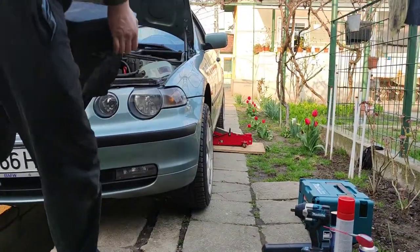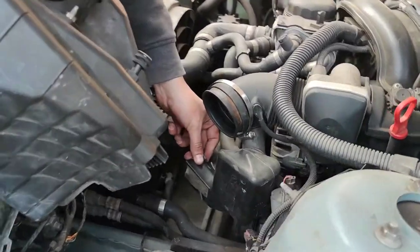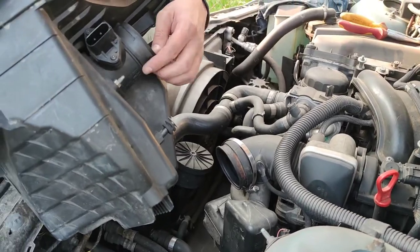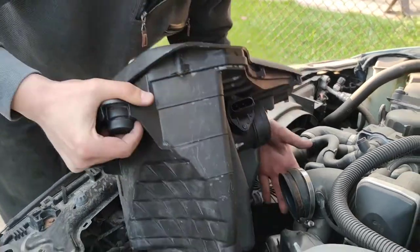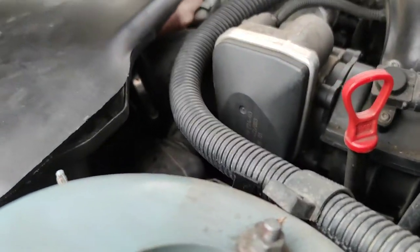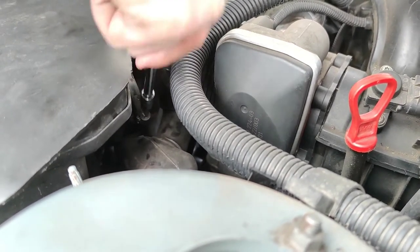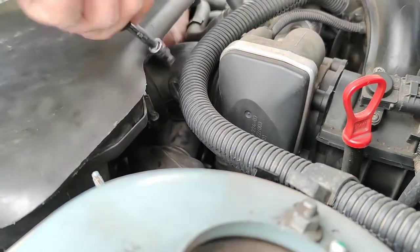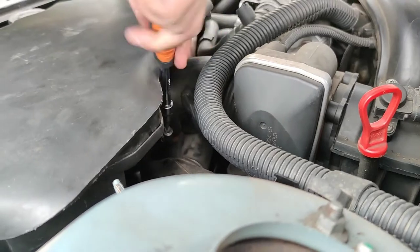Now we can put back the airbox. Put this little thing down here in the other airbox from below, and then insert the duct on the airflow sensor — make sure the rubber here on the airflow sensor fits well. Then put back the cable of the sensor. I put a little bit of grease on the duct and on the airflow sensor so the duct went inside pretty easily. Now tighten up the flat head screw holding the duct, then put back the sensor. That's about the air filter.